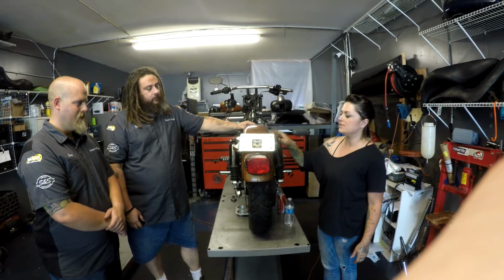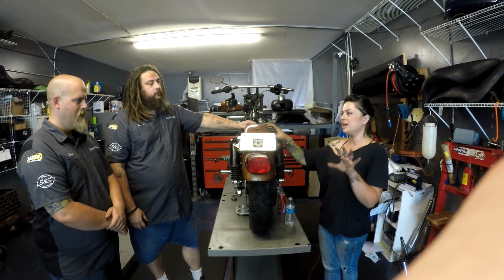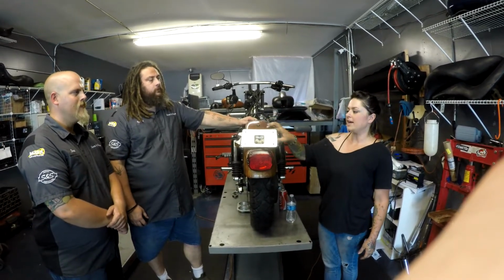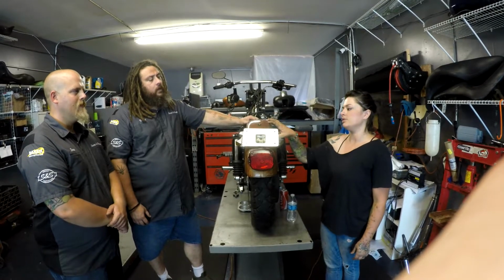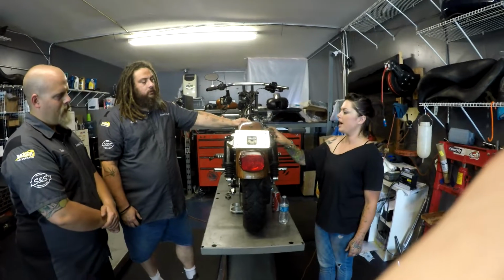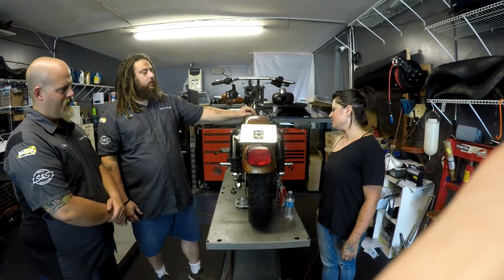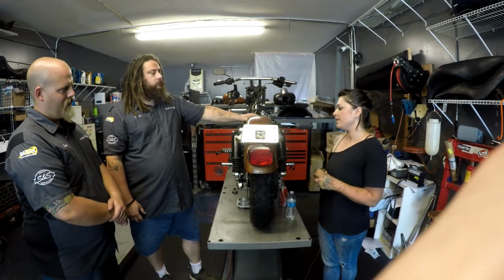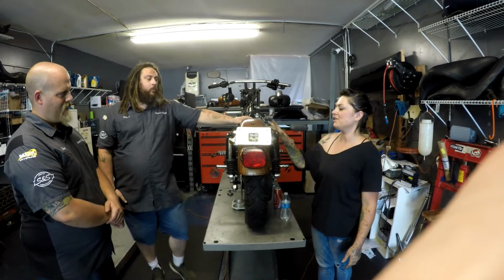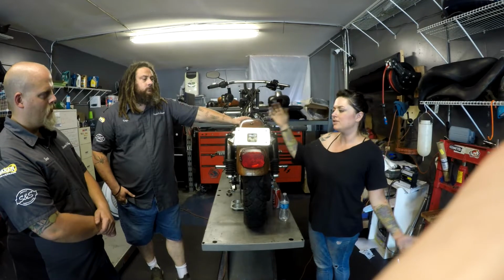One thing I noticed is if I left it in the sun, it turned a kind of flaky rock color, and it would just come right off. But if I put it in shade, then it would have a nice, thick, sticky rust to it. So it has to be done in the shade, it has to be done with distilled vinegar, and it just looks beautiful. I love the layers that came out on it, and afterwards we very carefully took it down and had them do a clear Cerakote over the top of it.